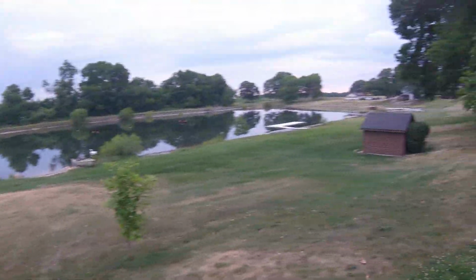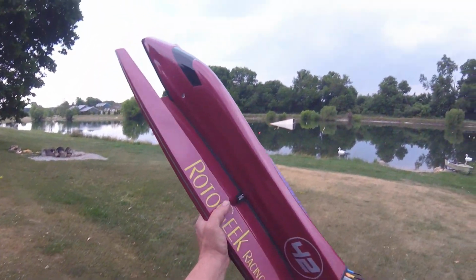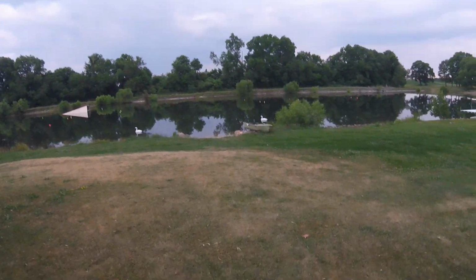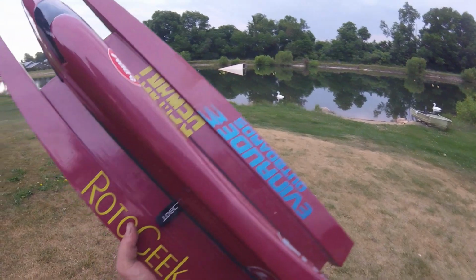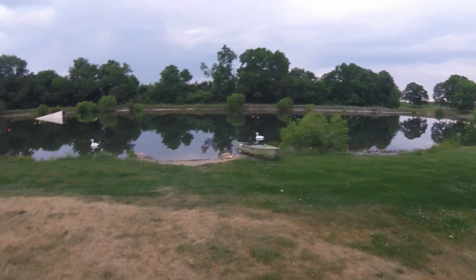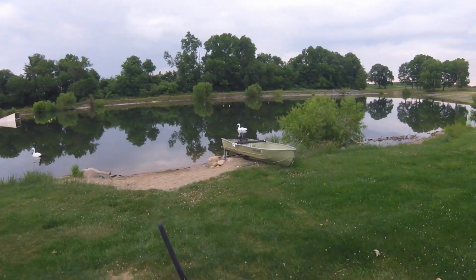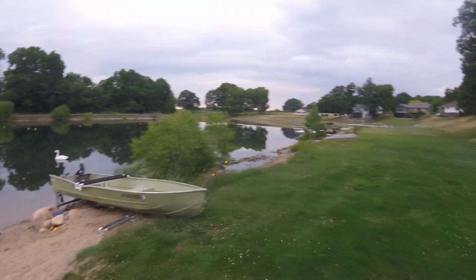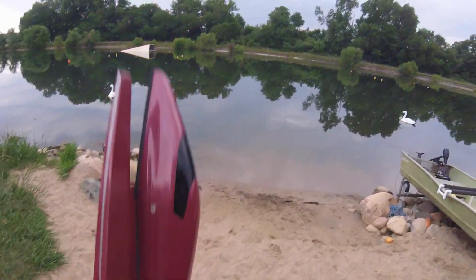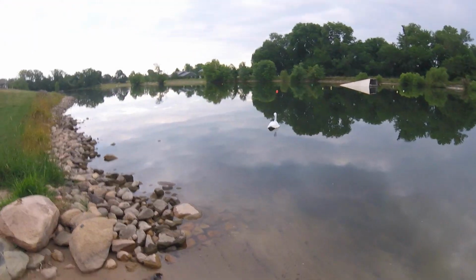Kids, we've been doing a lot of building lately on the tunnel hull and other things, so I decided to put a different motor in this tunnel hull. This is the Zip Kits 30 G30, I think. I put in a 2450 kV. We're still going to keep it on 4S. I ordered another kit, and I'm going to build another one of these, and we're going to do 6S with it. That should be interesting.